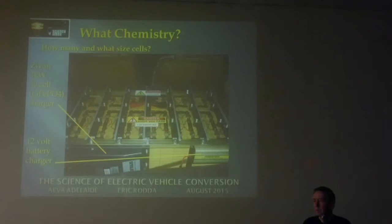The other thing it does is when you're charging the car, it monitors the high voltage for each cell. When a cell gets to 4.1 volts, it opens the loop again, the master controller knows it has been charging, and says, okay, turn off the charger. So it actually disconnects the charger from the mains. In my case, it's a 240 volt relay, and it opens up the charge. That hasn't happened for 5 years, because my batteries are now perfectly balanced, and none of the cells ever reach anywhere near 4.1 volts. So my BMS modules are not doing a lot of work.